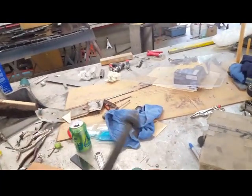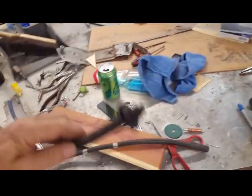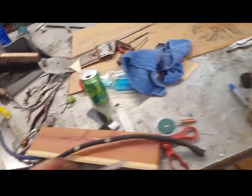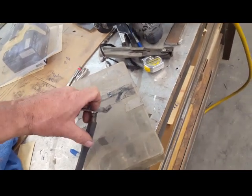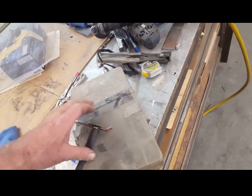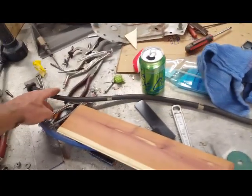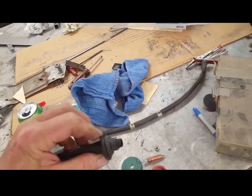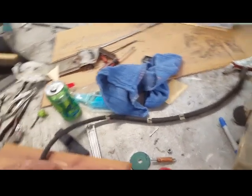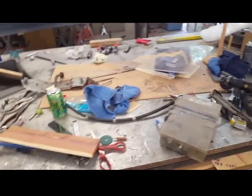I salvaged this from the four drain hoses off the sunroof of the car — it's perfectly sized. It's about a three-eighths inch hose that broadens out where this half-inch piece of 049-wall steel slips perfectly in, so I'll put a hose clamp on there and run the other end out through the bottom of the wheel tub. There's a nice little grommet there to pop through and hold it in place. You never know what spare parts you're going to end up using.